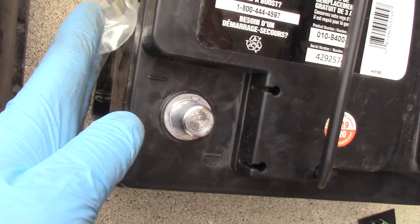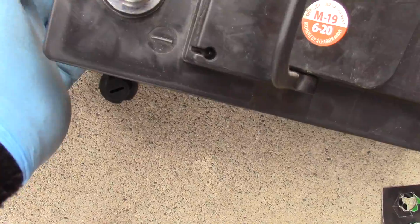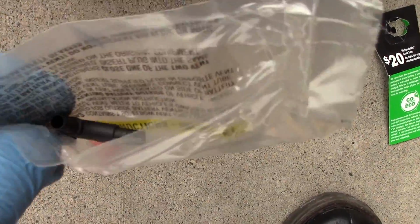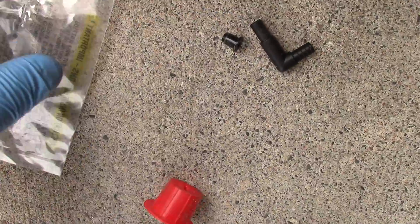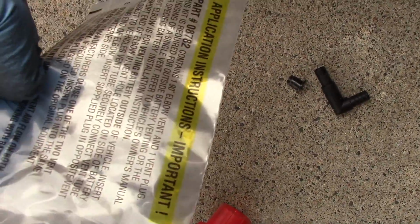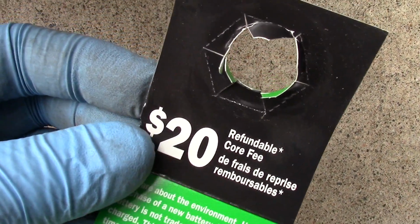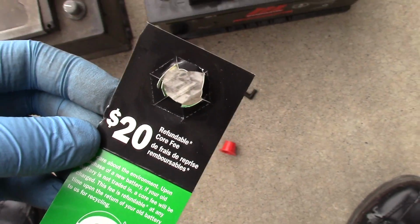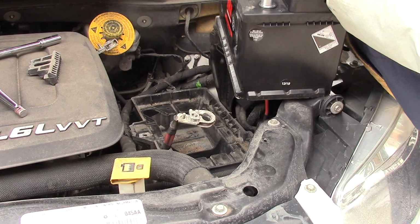At the side of the battery, you have this package. Some European vehicles like BMW and Volvo have vent tubes, and you connect this tube to the battery to stop buildup of any gases. So if your old battery has this, then you have a new one here to replace it. Also, if you live in Ontario, don't forget to return your old battery. You will receive a $20 refundable core fee. Comment below if your province or state also does the same thing.